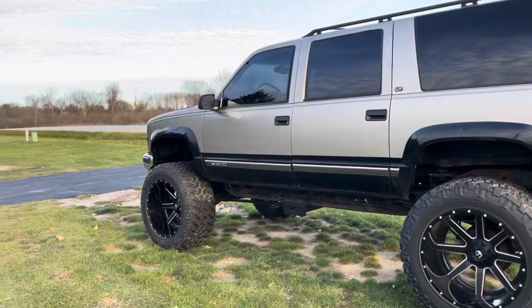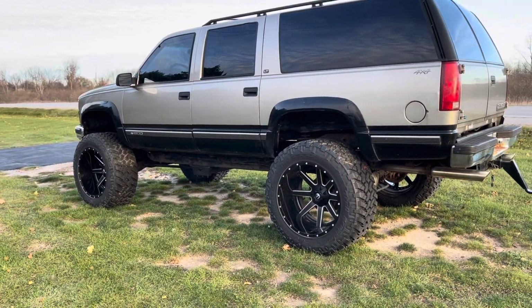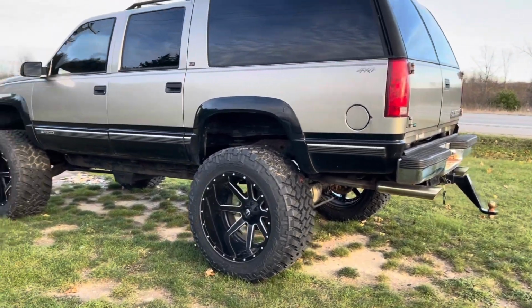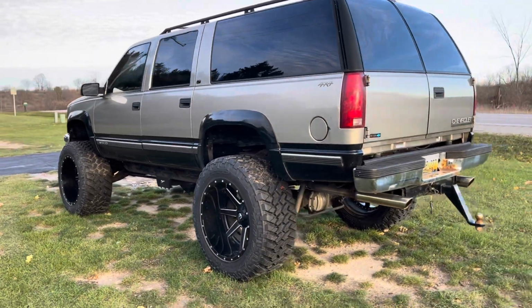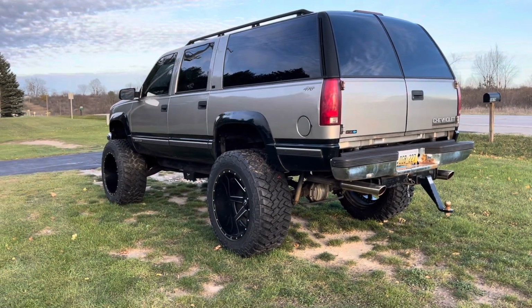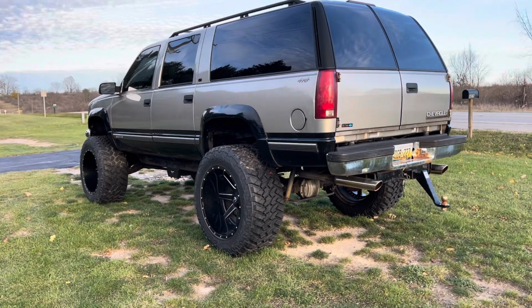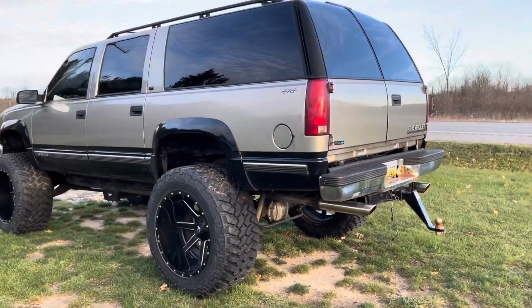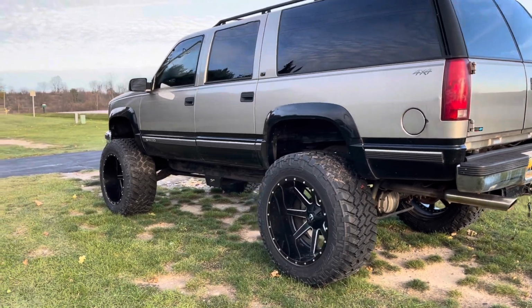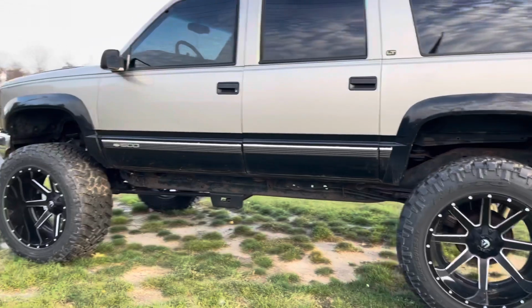Just the front 2 seats and dash are basically completed. Rear seat is in. I need to do the rear door panels, and all the wiring's complete. I just need to hook everything up. I built some custom boxes for 2 Kicker L7 10s with a Rockford Fosgate amp and a Kicker amp for the interior speakers. I got 6.5s all the way around, 2-ways with separate tweeters, so this thing should bang pretty good.